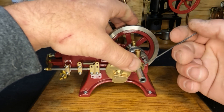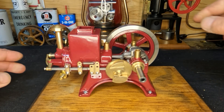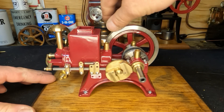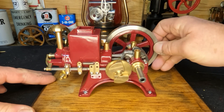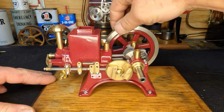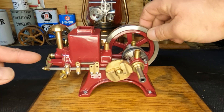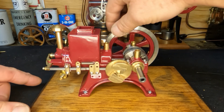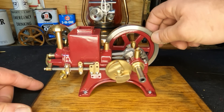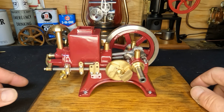Just snug it — we'll see where we're at, further tweaking may be needed. So this is our compression stroke... it fires coming up on bottom dead, our exhaust is opening, exhaust stroke just completed, and there we are. Our cam should be really, really close to being in time. Let's get the rest of this assembled — maybe give it a run tonight.